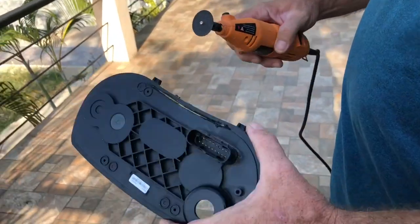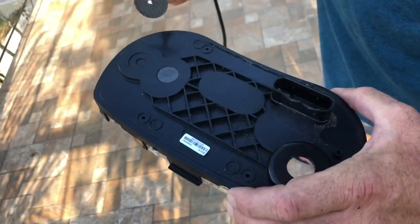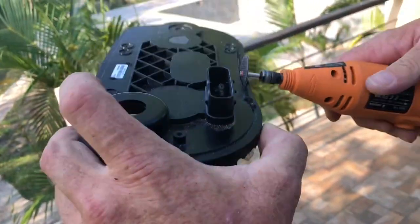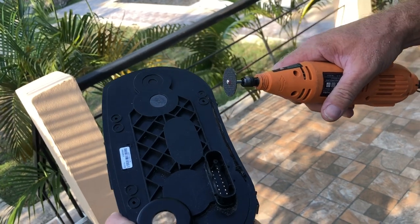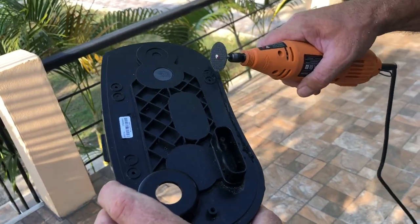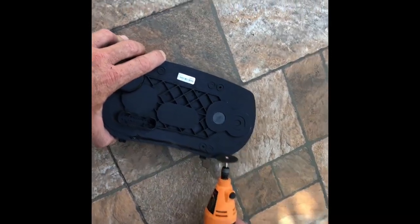The problem is: when you open up the display you have to use a Dremel with a big-size grinder and go all the way around this edge, about this line — open it, open it. It takes about 20 minutes all the way through. You can see my grinder. First you go straight, you can angle a little bit on the hand — angle it, all the way through. Don't stay too long on one place because the plastic gets very hot and starts melting. Go to another place, then again back, all the way through. Then you can take out the front.